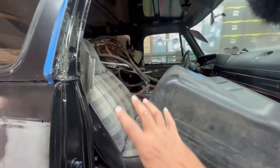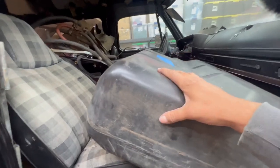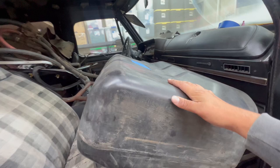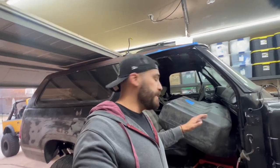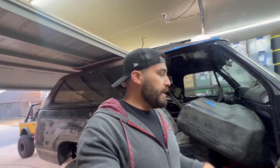The last thing that held us up was the fuel tank. Any vehicle that's been sitting 15 to 20 years, you've got to deal with the fuel system. Lucky for us the fuel tank on the Ram Charger is plastic. But when we pulled out the level sending unit and looked inside, it was a nightmare. To clean it, first we went in manually and scooped out the gunk, then we tried two gallons of acetone — filled it up, threw in a chain link chain, and swashed it back and forth after letting it sit for a couple of days. Then we put the acetone back into containers to dispose of it properly.